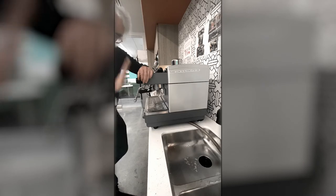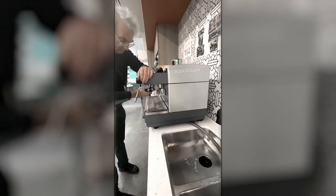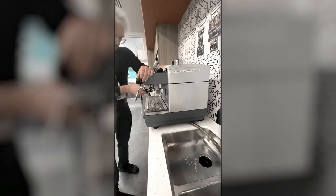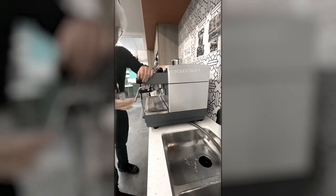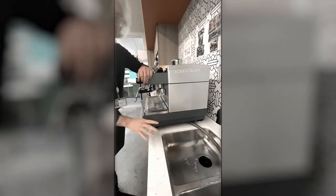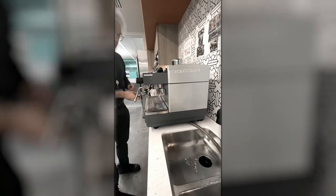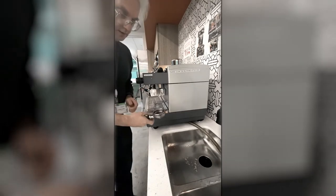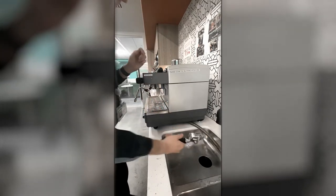So we've finished the scouring phase, and what you will do is you'll do those, release, hold, count, press, turn on for a count of 10, stop, let it discharge. You'll do that until the discharge that comes out is relatively clean in the sink. Having achieved that, we now go and dump. And you'll see there's still a little bit of scouring material here, but a lot of it's been used. We just dump that out.